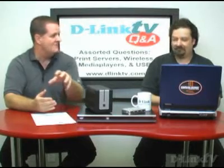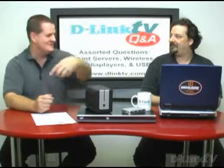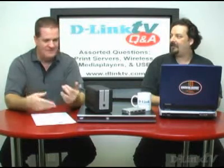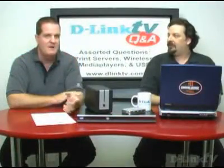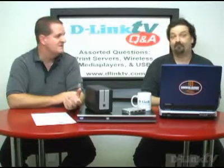The issue is your connection is going to slow down because of stuff happening on that PC, or the PC slows down because of the connection. And you don't get the stateful inspection firewall, the nice security, WPA2, all that good stuff — and all the cool features that come with a router, like dynamic DNS. I highly recommend you don't connect your PC directly to the cable modem. By the time you buy a wireless card for your desktop, there are wireless routers out there that aren't a lot more expensive and you get a lot more capability.